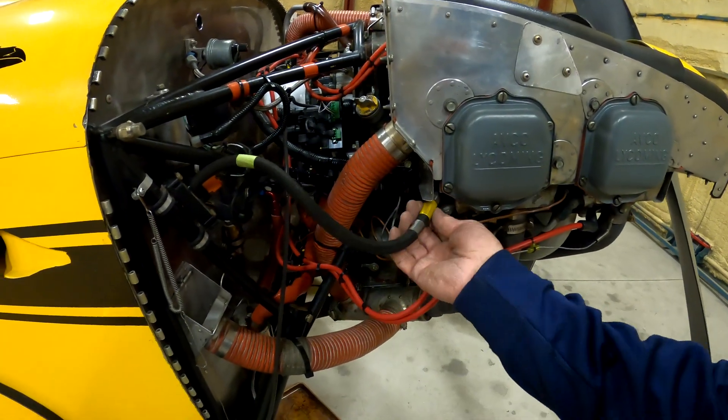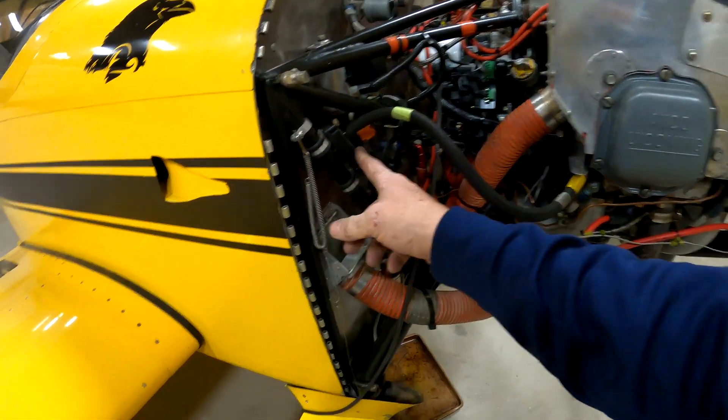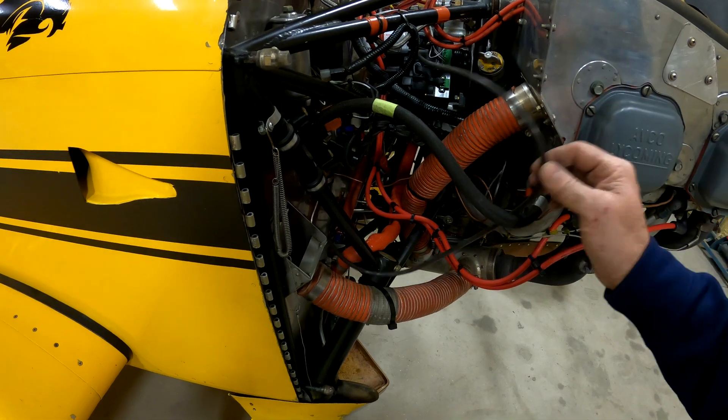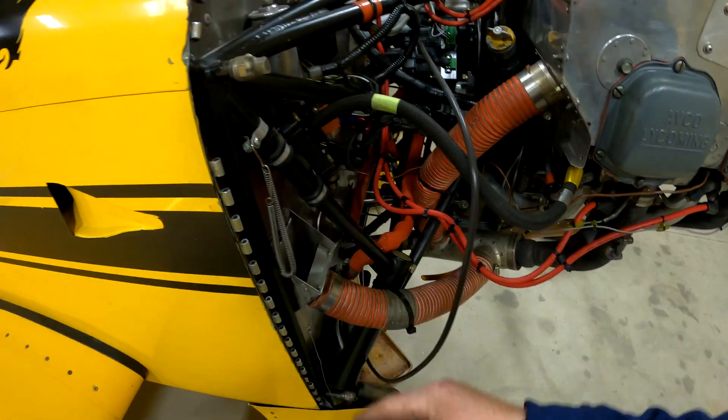I'm still waiting for a couple of parts. On this unit right here it's a little loose — don't worry about that, that's by design. There's a manifold pressure tap here for my manifold pressure gauge as part of the Dynon system. I'm going to tap into that and hook this line into there somehow, once I get my appropriate fittings and hoses. We're just going to tee that in so they can both work off of manifold pressure. Manifold pressure is what that mag uses to adjust its own timing, so looking forward to seeing some maybe fuel economy increases, maybe a little performance increase, and maybe a little more reliability — we'll see.